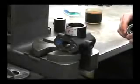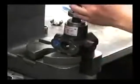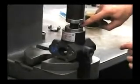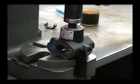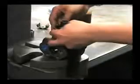We can go back to the press and reinstall the shaft and bearing assembly. To reinstall the shaft, put it into the pump body with the cam bearing facing down. You'll want to have something to support this bearing — make sure this is as straight as possible and don't force it, or you can bend these c-clips. If you do happen to bend those, you'll want to replace them. Press that straight down until the bottom's out, then reinstall this retaining ring.